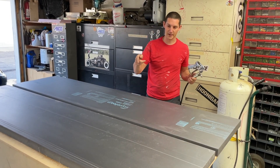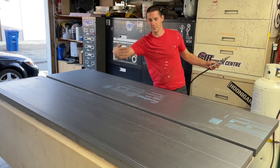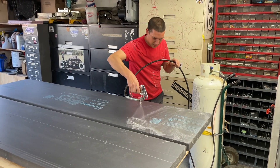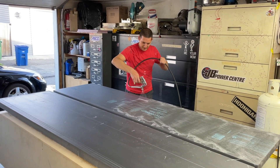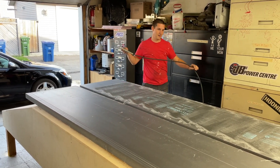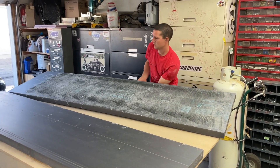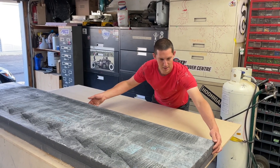What I'm doing is spray contacting foam onto the piece here — this one's already set. I put a nail here and here on the dead center line so I can keep that center reference line all the way down the car. If I spray too much contact cement on it it'll melt the foam, so I need to put a coat on, let it cure, and essentially seal itself — you can see how it's kind of melting and eating away at it. It's contact cement, so I have to let it actually set up and dry.